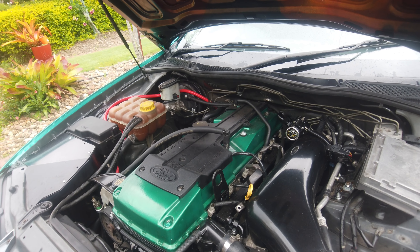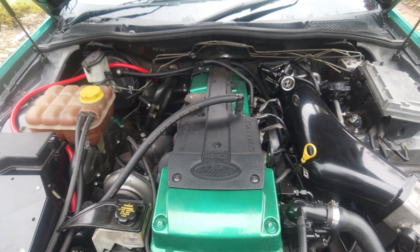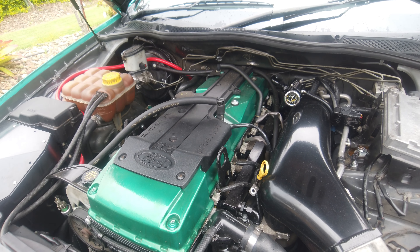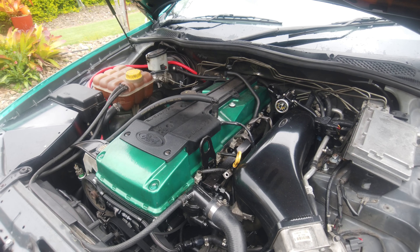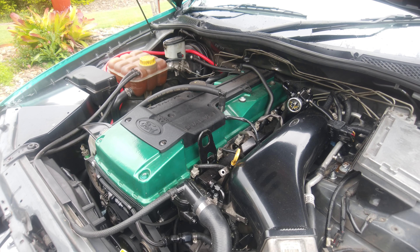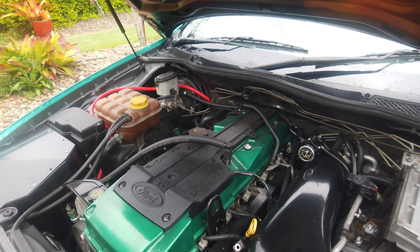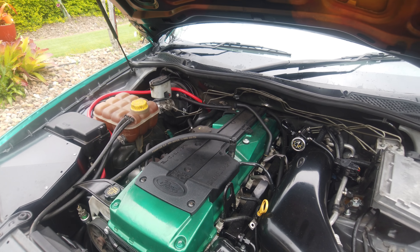That started my track to a never-ending money pit, but we've finished it now. We pulled the motor out once we found that out because I wanted to make 600 horsepower or more, so the BA motor wasn't going to cut it. We pulled the motor out and started the rebuild. The rebuild consisted of the block and head being sent away — we went with an Atomic Six 698 rebuild kit, so forged pistons and rods, oversized. The block had to be bored out to fit the new pistons, which is a good thing when you're doing a rebuild anyway — fresh bores, everything's fresh, no imperfections.